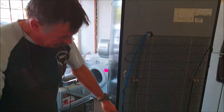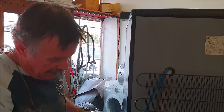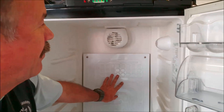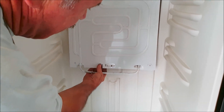What I've done is I've mounted a thermostat here made by Danfoss — a normal two-door fridge thermostat. Inside this blue sleeve the capillary runs, and I'll stick it through this hole where the suction goes through. I connected two electric wires to the thermostat that run down to the compressor. The two wires that run from the PC board to the compressor — I've just broken one of them and run the thermostat through that broken wire. On the inside of the fridge, the suction comes through so the thermostat capillary comes through, running behind the cold plate, and I've just clamped it on to it.